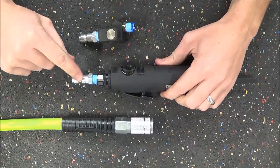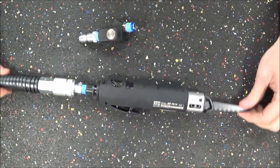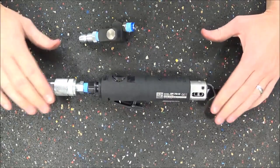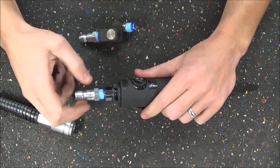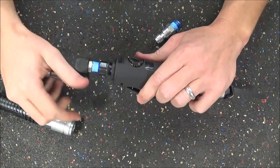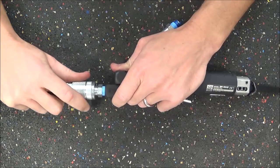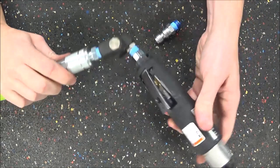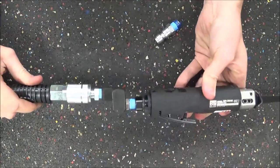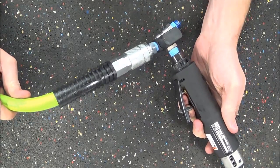With the saw with a plug right in the bottom, and you take your coupler along with the airline, now we're dealing with something very long that's not going to bend. In a very tight situation — let's say underneath a vehicle — this could prevent you from getting the job done. If we take the standard air fitting, unscrew it, and put the swivel fitting in its place, you'll see very quickly why it's so important. Taking that same swivel fitting, I'll plug it into the same airline, and at this point I can articulate it around and move it very freely around the hose. I'm not stuck in one position — I can move it around and the air hose is not going to prevent me from getting the job done.